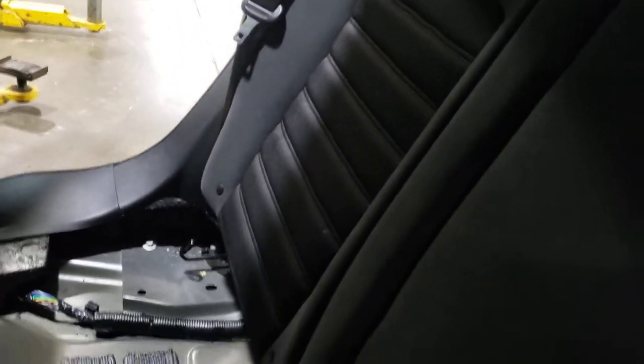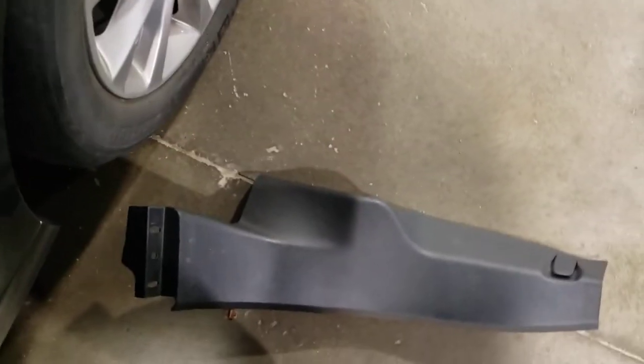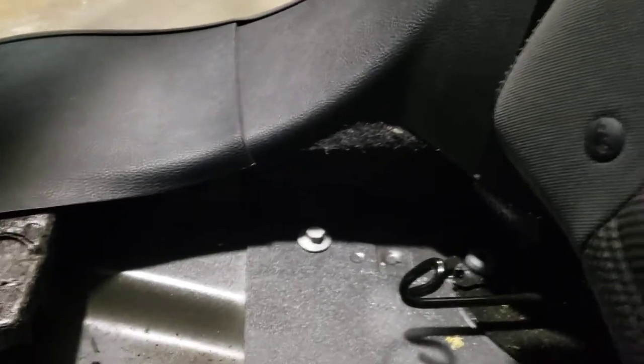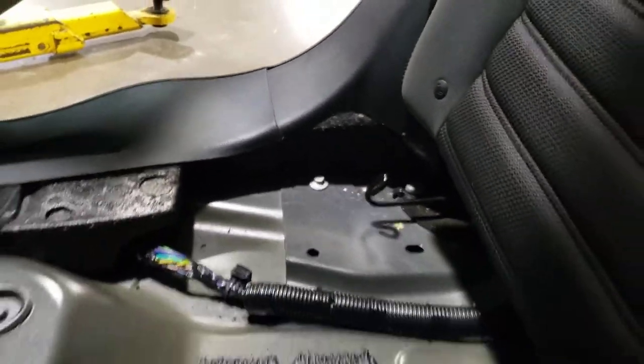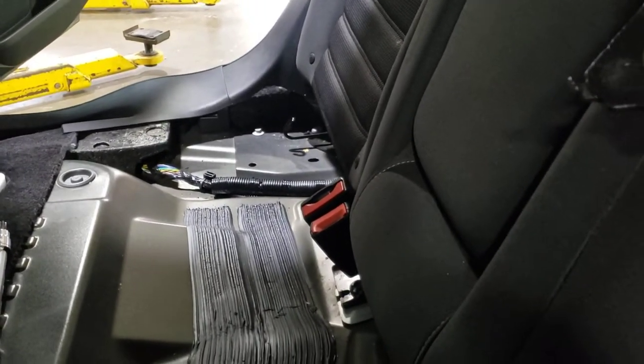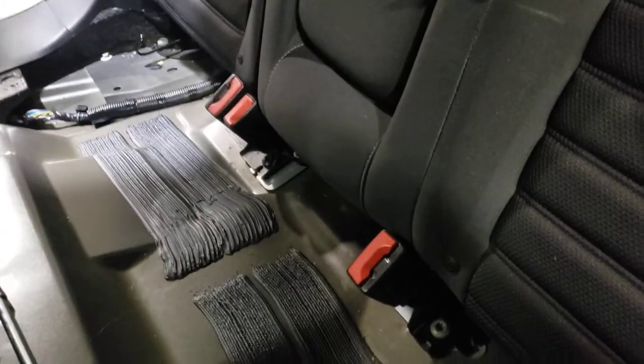Everything's good on this one. I'm waiting for the center seatbelt and the passenger seatbelt. One thing I noticed is you'll need to get a new trim panel piece, because apparently on the one with the inflatable seatbelt it's cut deeper to fit over this. It almost looks like it would fit, but it will not — I've tried many ways and I can never get the trim panel to fit. So I'll be looking for that too. Thanks for watching.